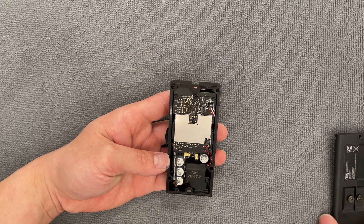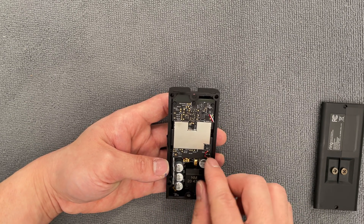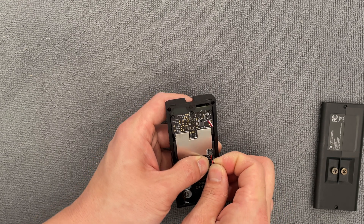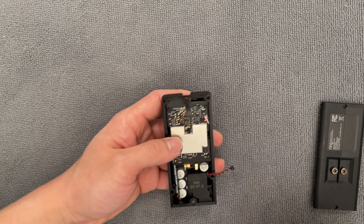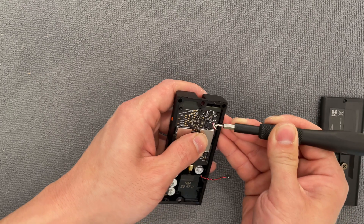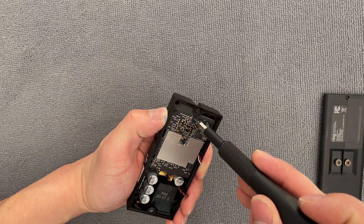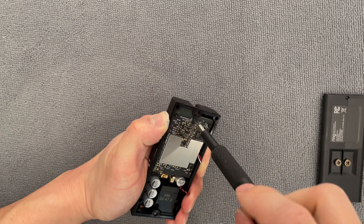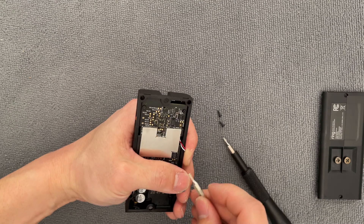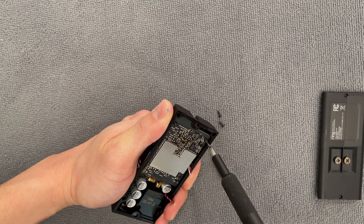Here is a look at the internals of the device. The back just pops off after you take apart those few screws. There are a few connectors here — this one looks like it's possibly the speaker, so be pretty gentle and just pull up on it. I'm not sure what this one on the top is right now, but we'll go ahead and undo that and I should figure out once I get this back off. Up here we have a few more T6 Torx screws, and it actually looks like these two are smaller — those are a T4 Torx.